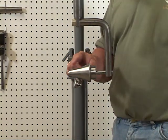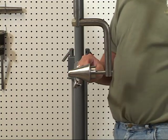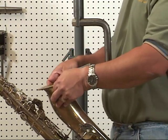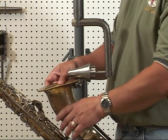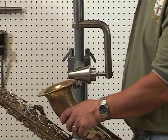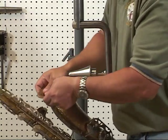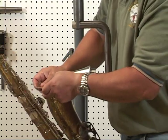We've already set up our mini disc roller and our curved arm to allow us to be right at the point. Once again, we work it like a steering wheel. We'll work it from the backside. We'll work from the rim and we'll work out. It is simply around the rim in the different areas that we're needing.